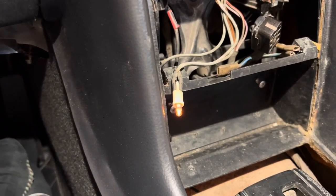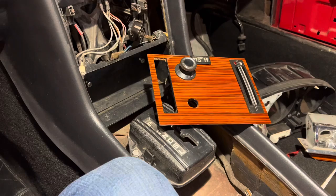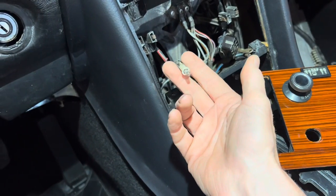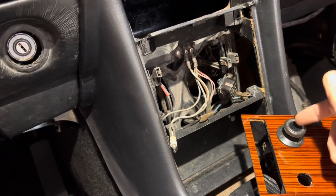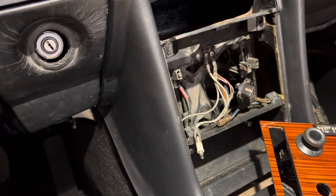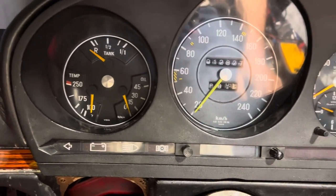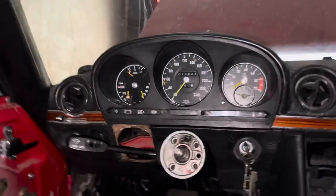When we now turn the lights on, you can see that the light bulb lights up, and furthermore the dimmer switch makes it dim and undim. We have now fixed all the lights in this car: a permanent 12 volt source to the shift light which works fine, variable 12 volts to the slider and panel lights, and the fan earth issue has been resolved. With the wiring correctly in place, everything works as expected, so we can start putting this back together and move on.